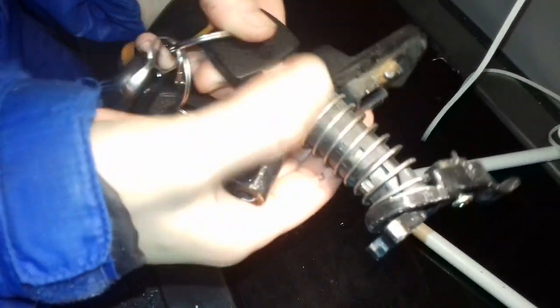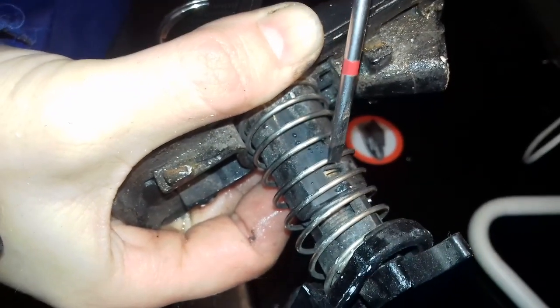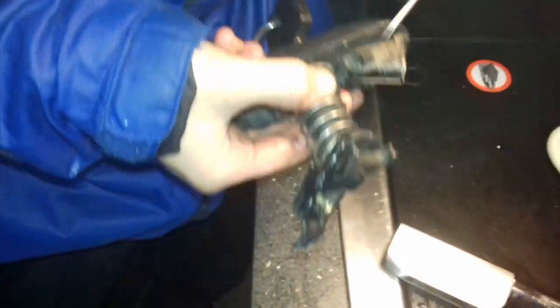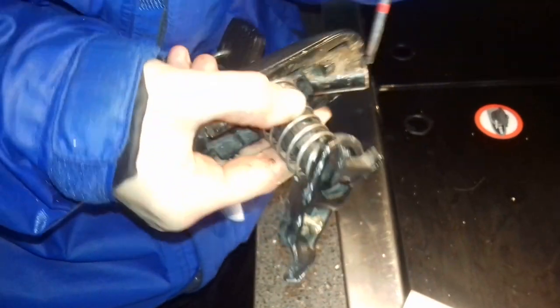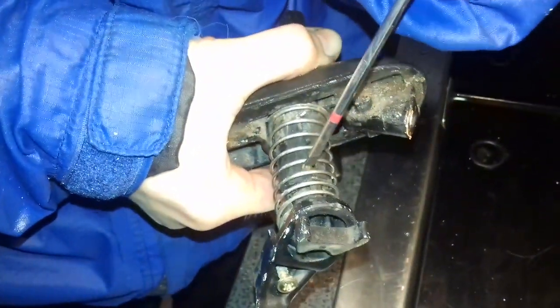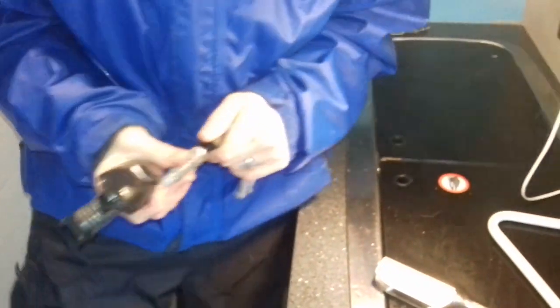You can see just where the barrel is clipped in — you need to press on that and then pull the key back to get it out. The key needs to be in that halfway position so you can pull the barrel out while pressing down. It's a bit awkward — use a small flat-head screwdriver. You can see it pressing in — and yes, well done!